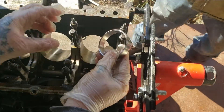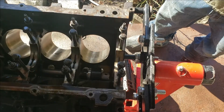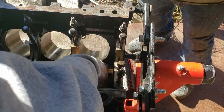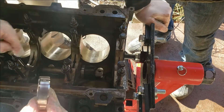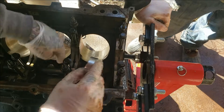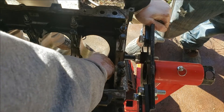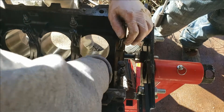The trick to this is finding your oil galleries. On this LS, it's kind of right here. Those cracks on this little tool here — you can line your oil gallery hole up with that crack so you can pretty well eyeball it and get it exactly where it needs to be, without having to mark the block and all that. So let's go ahead and feed this on.